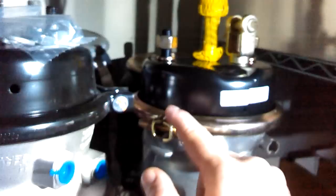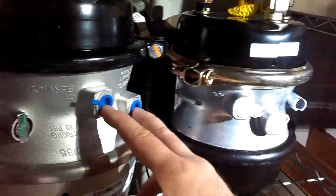Or you could take this mechanical flange apart. First, cage the brake chamber. Then you could take this mechanical flange apart. Then cage your old one, take its mechanical flange apart — you're still going to have to undo the airlines, chalk the wheels, relieve all the pressure off the air system, and take your airlines off. But then you can change this part without even having to cut that rod. You'll take your old one off and put the new back end of your brake chamber onto the already-mounted front, and get off a mount real quick — handy if you're on the side of the road in the cold.